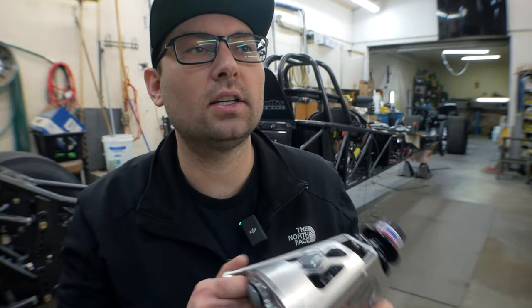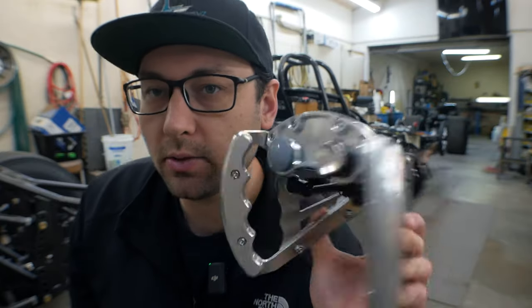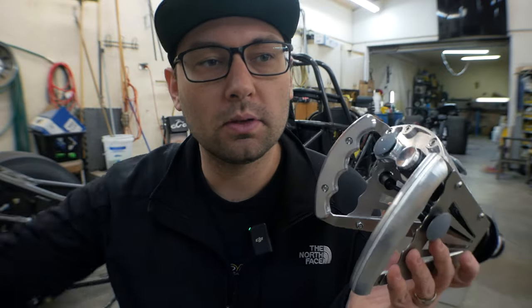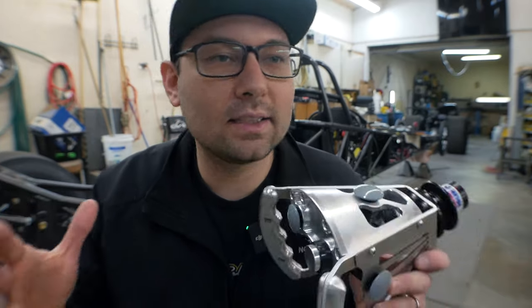The path I went down — I kind of stole the idea. I got the initial idea from a product on the Motion Raceworks website, where they have basically a monocord system with a Deutsch connector quick disconnect that enables you to run four buttons on your steering wheel with one cord. When I saw that, I thought, that's what I need. Problem I ran into immediately is that I wanted five buttons on my steering wheel instead of four, so their system is only capable of using four buttons. So then I went down the path of figuring it out myself and designing it to be capable of five buttons.